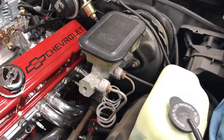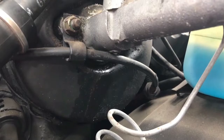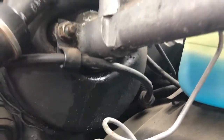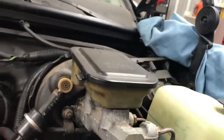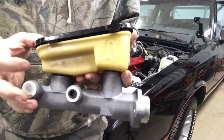On this vehicle I switched from rear drum brakes to rear disc brakes. I got to looking at this master cylinder and saw it was leaking out of the back of the seal, so I'm getting ready to replace it and I'll show you how that is done.